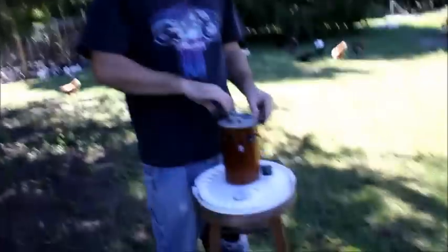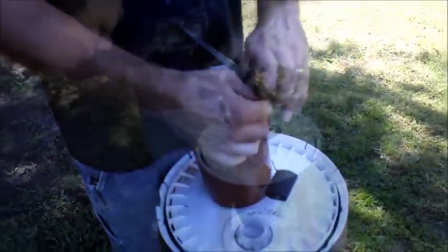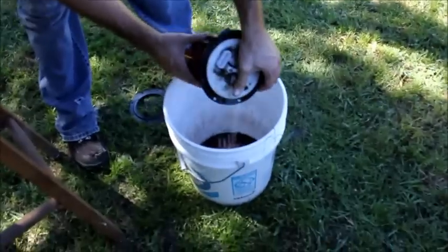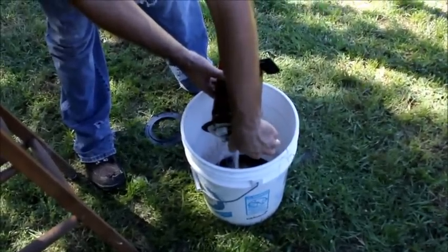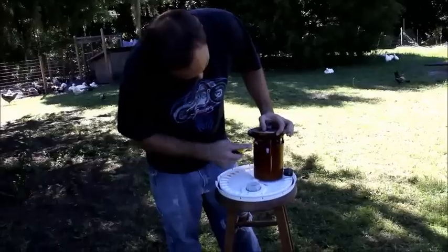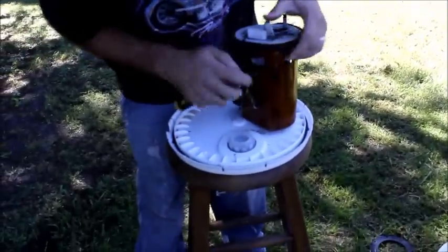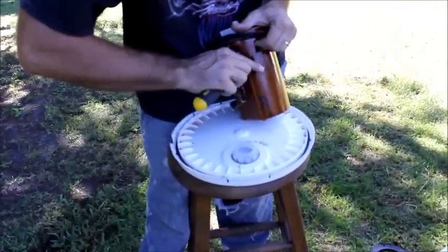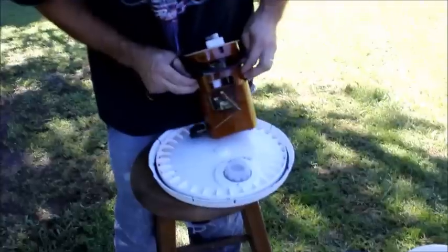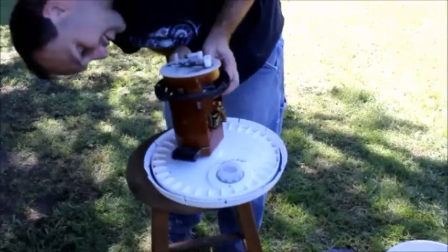You can take off this little top ring. It's basically held on by these two nipples. Next we need to open this assembly up, but first we are going to drain it. Make sure you drain your fuel and dispose of it properly into a bucket. After you drain the fuel, you want to take the top assembly off - just simply press these tabs in. Of course I start on the hardest tab.